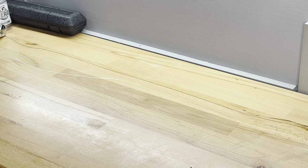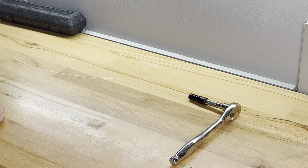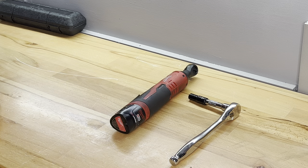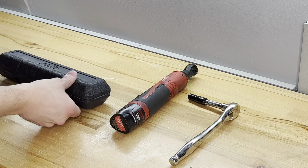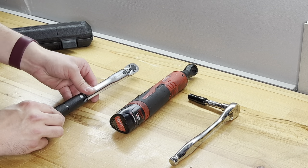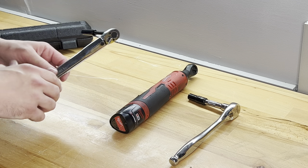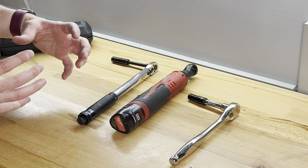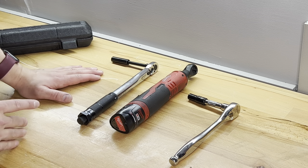For today's install, to remove the supercharger lid and remove the sound deadening plate, you're gonna need some tools. You need a 10mm socket — I'm going to use a 3/8 drive wrench with that. I'm also going to use a battery-powered ratchet to help get those out and put them back in, but I'm going to go hand power to get them snugged on. You need a small torque wrench capable of doing inch pounds, because the proper torque setting for the supercharger lid bolts is 89 inch pounds. The sound plate itself is held on with a Torx T20.